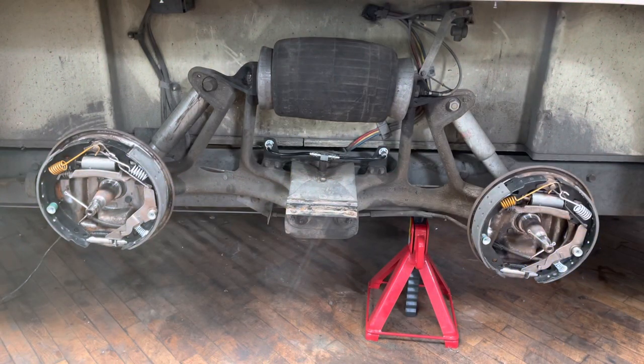Replacing your airbags is extra easy if you do one side at a time. Lift up the coach, placing the jack on the bogey — that part in the middle between the rear wheels — and your jack stand on the frame rail where the frame rail is doubled up. The frame rail is doubled up in this rear wheels area; if you crawl under there and look, you will see what I'm talking about.